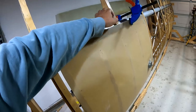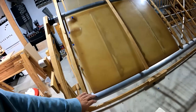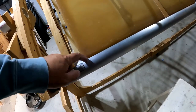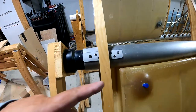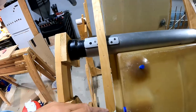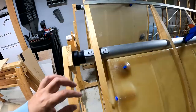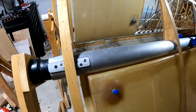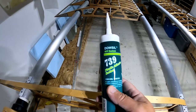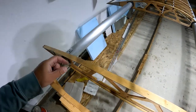Now I have my left wing number two rib trimmed and fit in place — that just took a few minutes. I'm laying out my strategy for bonding the tank in place. On the forward edge the contact patch is pretty significant. But on the rear tank there is quite a gap — if I had sealant all over that edge it's probably not going to even contact. From about the 90-degree tangent point around the corner will be sufficient, but any sealant around the gap area is going to be a big waste of time — that gap is almost three-eighths of an inch.